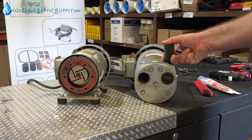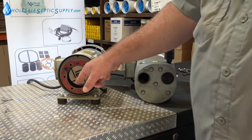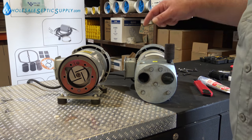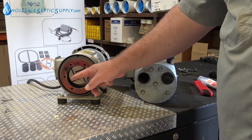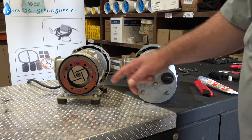This filter here is very important. If you clean this filter, the vanes will last longer because they lay a film down on the counter face, and that film helps them wear against their own material. If the inlet filter gets dirty, it starts scratching away the vane material that's been laid down and they wear much quicker.